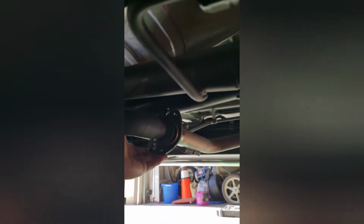So this too with the 4 bolts. But when we're tightening up these bolts, we got to make sure we tighten all 4 of them evenly, and we put the pressure going upwards, because you don't want to tighten it up sagging. All right, so we got these pipes lined up to the stock, and then you can see Ed is putting the bolts here.